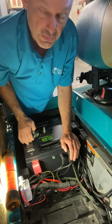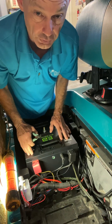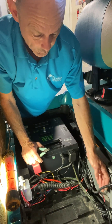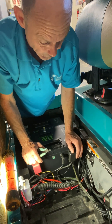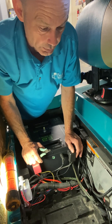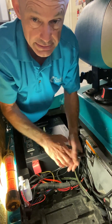Hey Jim, we're going to figure out which one of these wires goes where. This is my wife's cart and I'm trying to do this video so hopefully you'll be able to see everything. I'm going to probe these wires to the bucket harness, which is where your tail lights and turn signals all go to, and we're gonna find out which color wires go where. Chances are the color of my wires are going to be the same as yours.